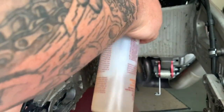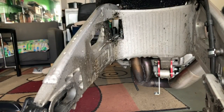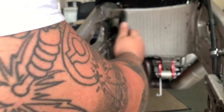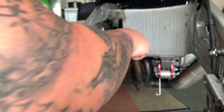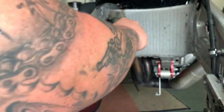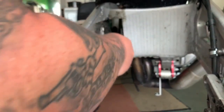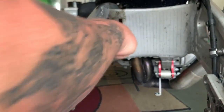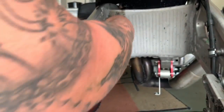We do stuff like this because it's not very often you've got the wheel off and time to clean the butt side of the bike. So while it's off, we might as well take advantage of it. Clean all this grease off the swing arm. Also inspect your chain guide, this plastic piece that the chain rides along, because after a few chain swaps, usually they get kind of worn out. You don't want your chain flopping about. So I'll time lapse you guys while we do this.